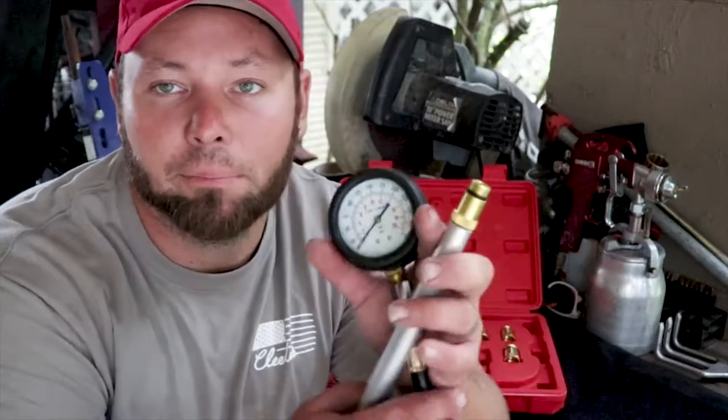From the wet and dry comparison, you can figure out what's wrong with your motor — whether it needs rebuilding or is good to go. If you've got good compression but you're still low on power, the next step is a leak down test, which tests the valve train. I'll leave a link in the description when I cover a leak down tester.